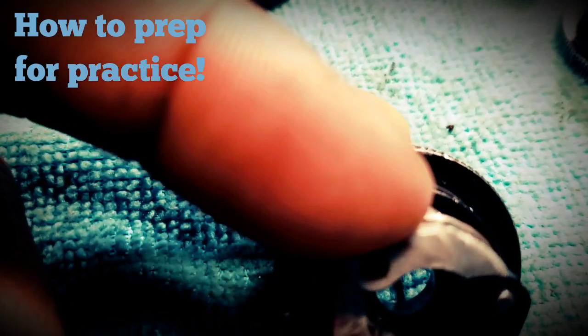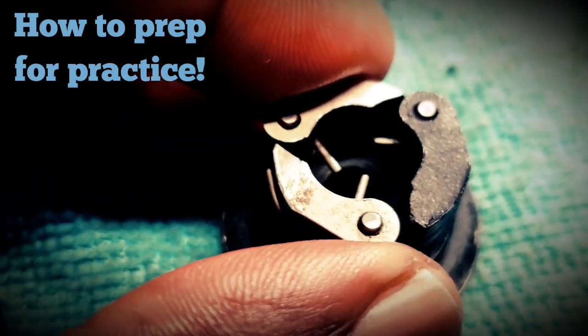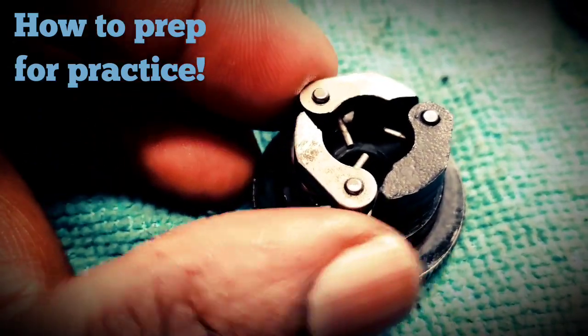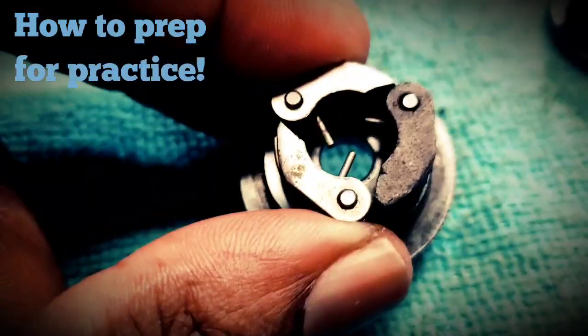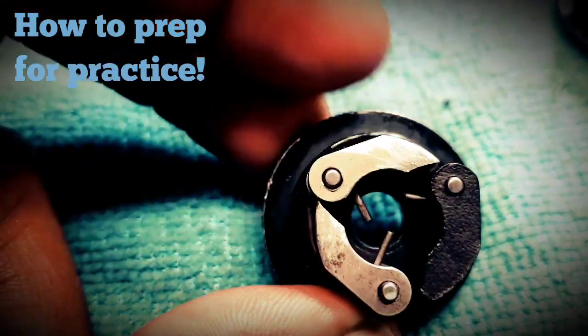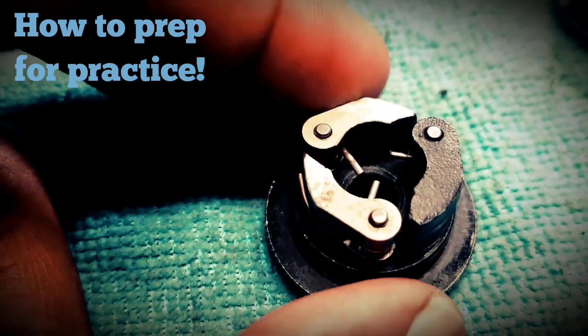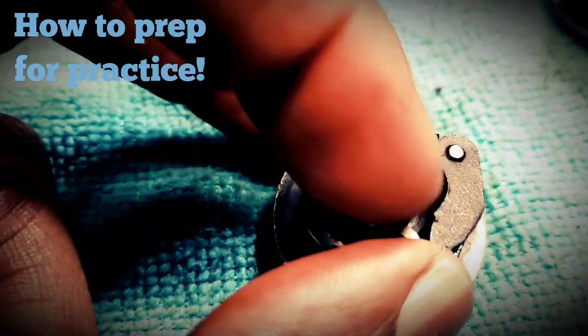If you're going to practice, still practice with good stuff like these shoes. They're pretty good, don't have any flange ends on them, nothing like that. The springs are good, 1.0 springs. Just because I'm using this stock setup that comes with my kit, I'm still using good clutch shoes and clutch springs.